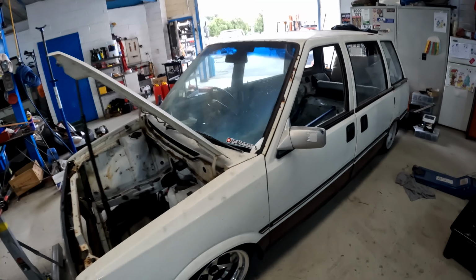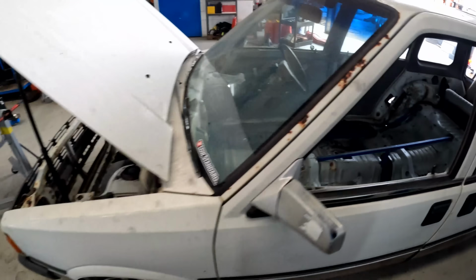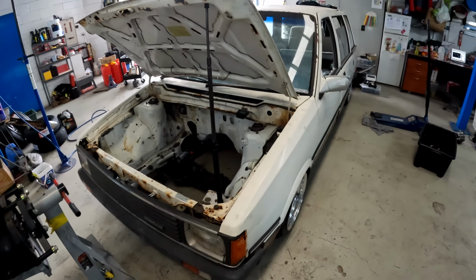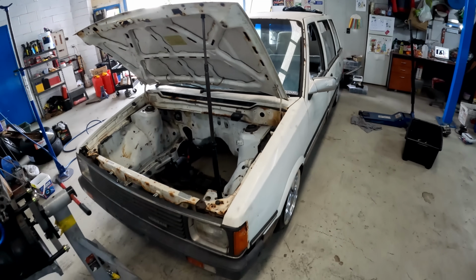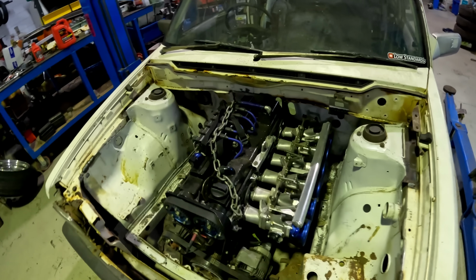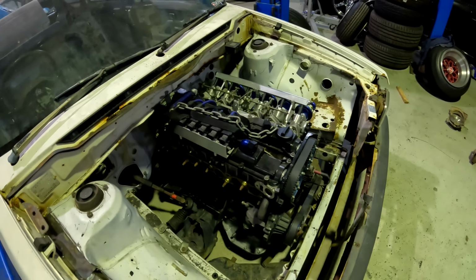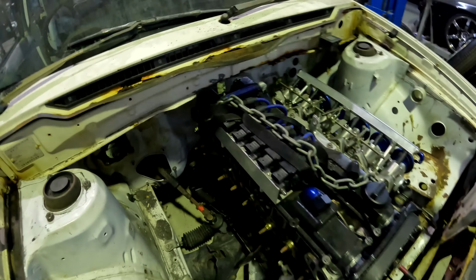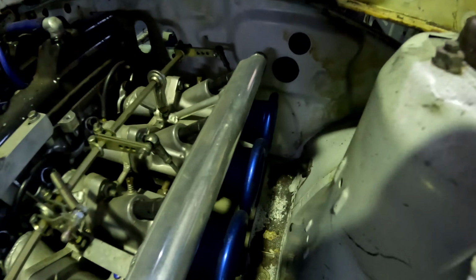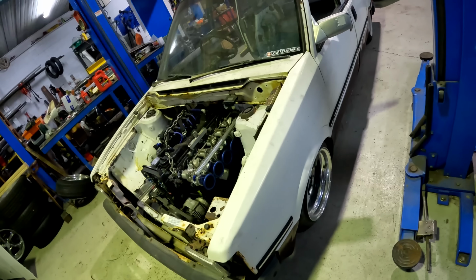This excites me. So yes, today, the engine is getting slammed in the engine bay, and we'll know where we're at, start making mounts and whatnot. Motor dumped in there, needs to go back about 60 mil. So I have to do a bit of a tunnel on the firewall, recess. Yes, it's all pretty tight, but literally been dumped in there, so not bad.